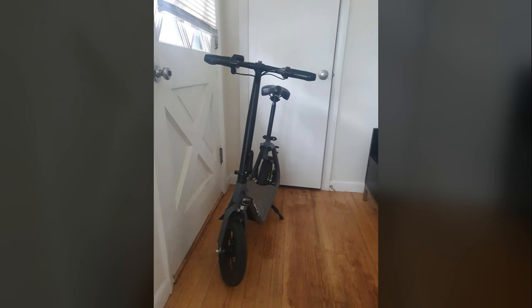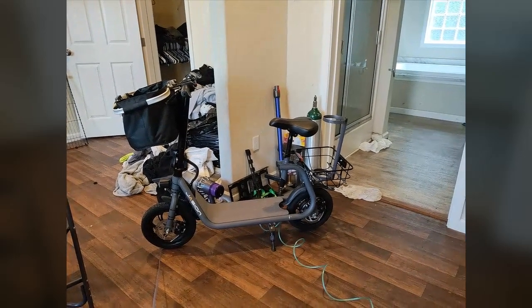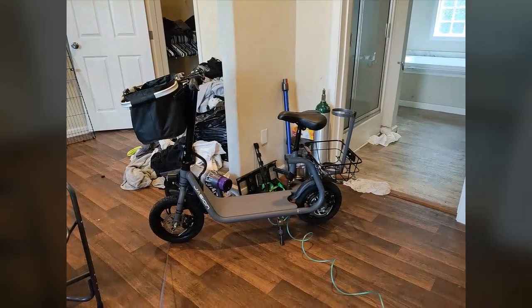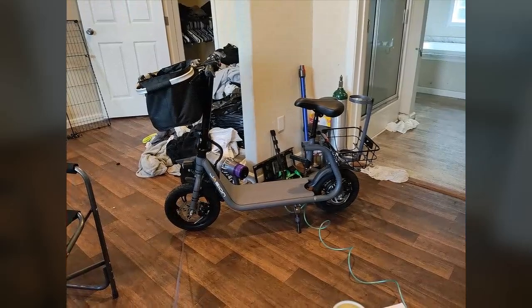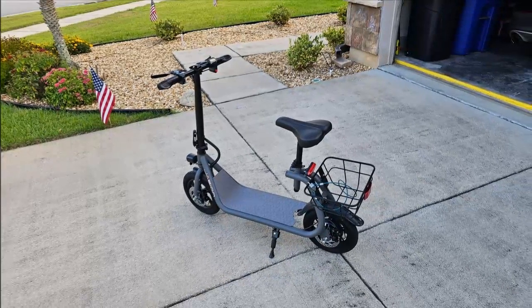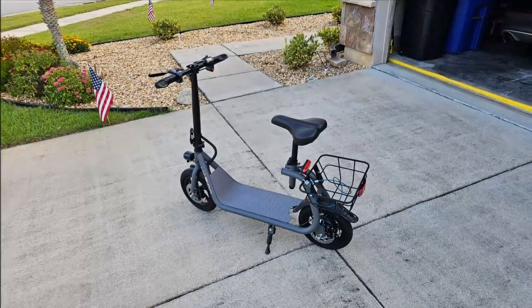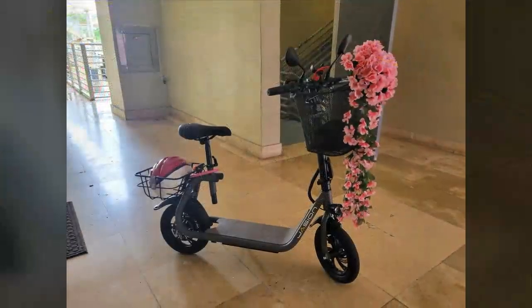More substantial critiques focused on the scooter's design and build. Adjusting the handlebar proved cumbersome, requiring the collapse of the steering shaft, making it difficult to maintain alignment during tightening. The lack of a rubber liner inside the wheel rim was seen as a significant flaw, increasing the risk of inner tube punctures from chafing against the metal.